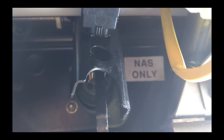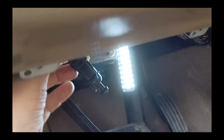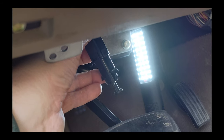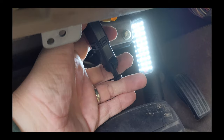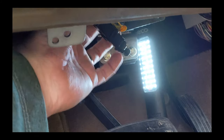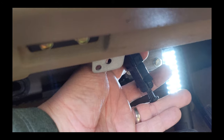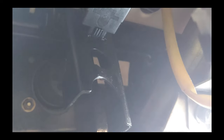That click is the button getting hit. The other switch I said I didn't know what it was for is the cruise control. When you engage cruise control, the moment you tap the brake it will compress and kill the cruise control. So basically what I had was, if cruise was engaged, you'd essentially have no way to disengage it from the pedal. The cruise control switch is going to mount back in the bottom round hole.